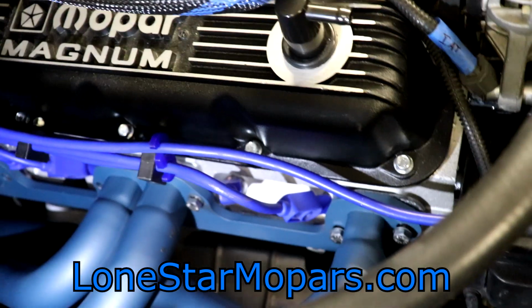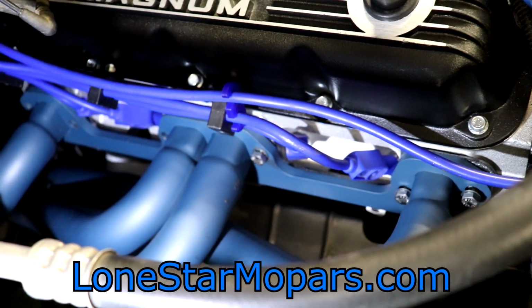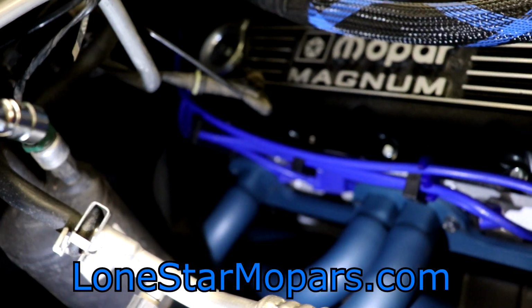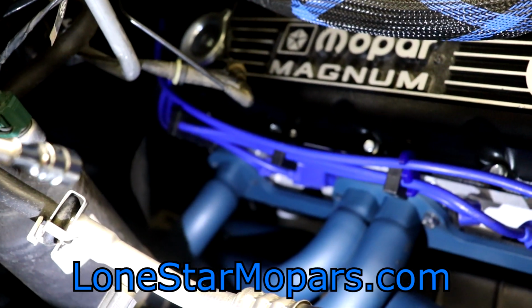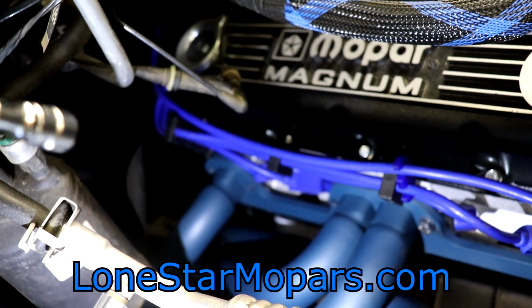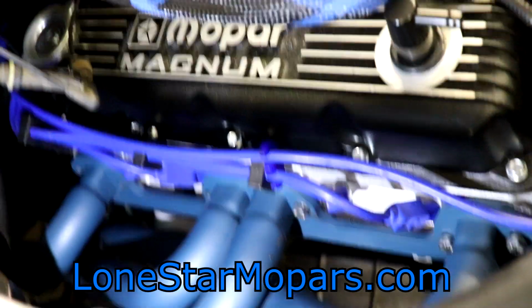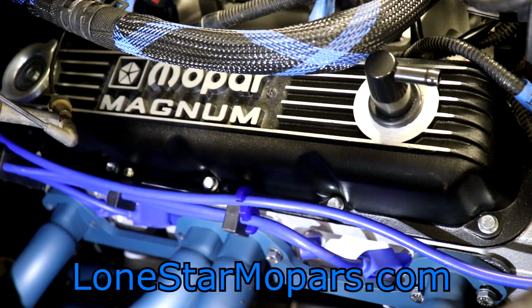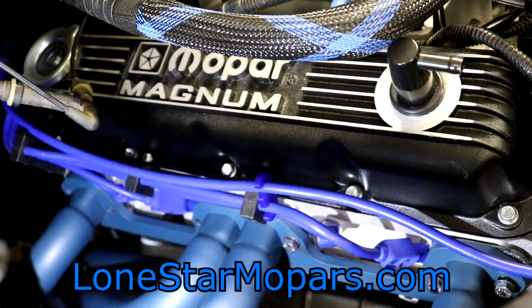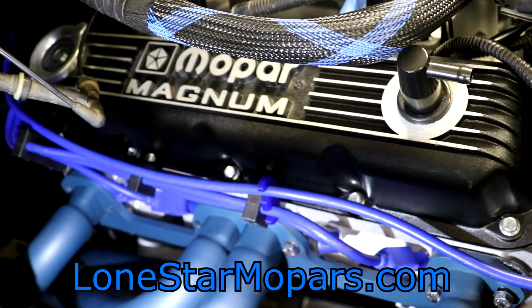Alright, so I had supper. I've thrown these in. They drop in way easier than the driver's side. The driver's side mainly interferes again on the firewall side of things. It's really tight against the frame rail, but your point of interference with the starter off anyway is the firewall. That said, we have an issue here. On this side, the driver's side, the gasket stayed in place on the head. This side it came off, and subsequently it's presented issues as I try to put it back in place and get everything lined up.